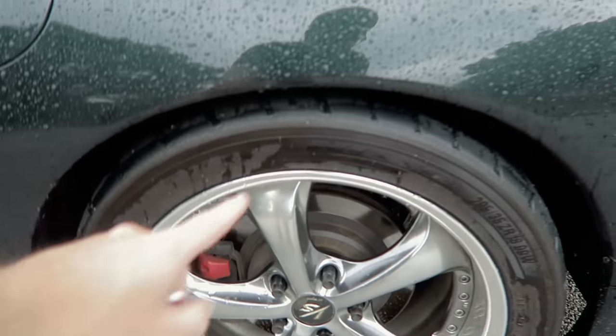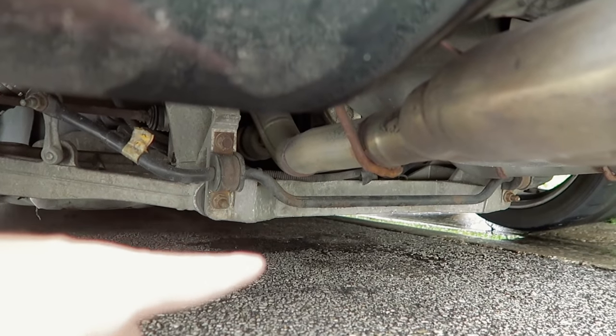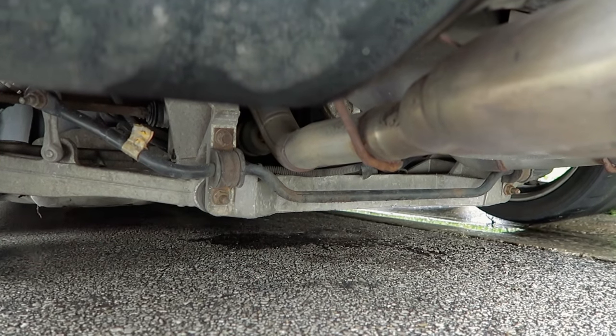The rear could go a tad lower. The goal is to make it to where I can get a jack under that subframe without having to drive on wood. It's not worth the extra quarter inch of drop to me to have to drive my car on wood every time I need to jack it up. So I think we're gonna raise the front half an inch and then see where we need to be with the rear. And then that'll probably be final ride height. So we're gonna do that real quick.